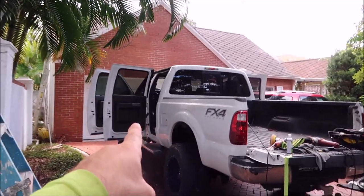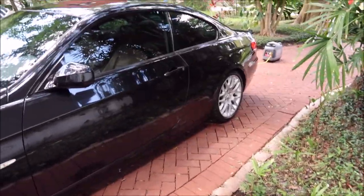We just completed this BMW 328i. Tony did most of the interior — cleaned the leather, wiped things down. On the outside, the trunk lid was incredibly oxidized and now it is not. It's still defect-ridden and not perfect, but I was able to cut probably 95% of that oxidation out. Now it's glossy and you can't tell it was oxidized. I polished the whole car with universal all-in-one.